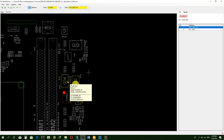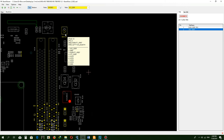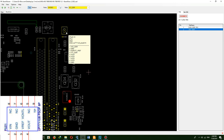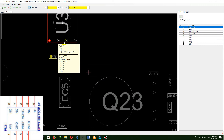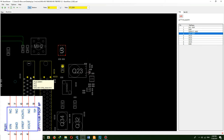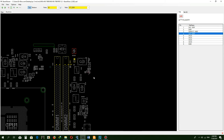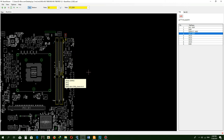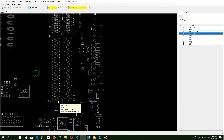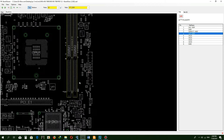The next sub-voltage is VTT DDR, which is generated from 1.5V of RAM VCC — specifically half of 1.5V — by means of a switched-mode regulator. Pin 1 is the input and pin 4 is the output of the regulator. This voltage is present on pins 120 and 240 of the RAM slot. RAM VCC also has another associated voltage which is plus 3V switch. I'll check that later if RAM has a problem. I don't have much to do with this block for now.